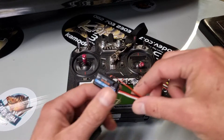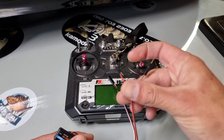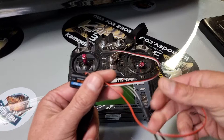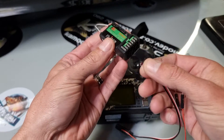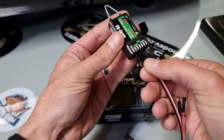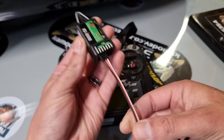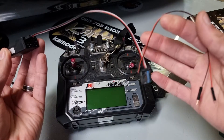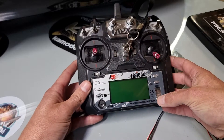So you're going to get the sensor — it's got a positive and negative that goes onto your positive and negative in the boat, and then you're going to plug that into the sensor port on your receiver. That will connect onto your battery. Let me just show you how to set it up and answer some common questions.